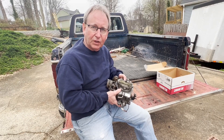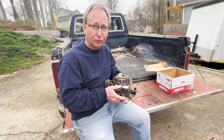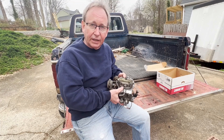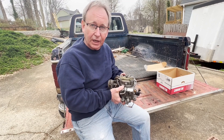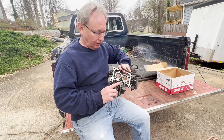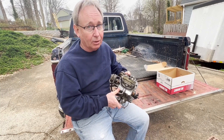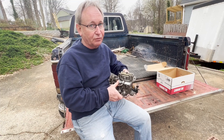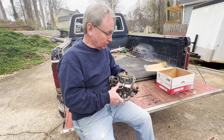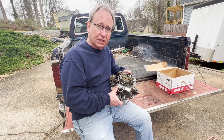Hey there, future me here to introduce a video I actually shot quite some time ago. The video will show you how I found and fixed and actually had this very carburetor back in service, but I just decided I wanted to replace it, and so now the engine's got everything new on it. A power valve failure on this Motorcraft carburetor — and probably any carburetor that has a power valve where it's vacuum on one side and fuel on the other — can really lead to some serious problems quickly. So without further ado, let's get into the video.